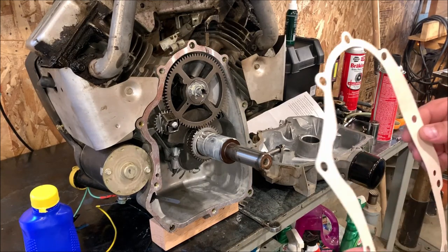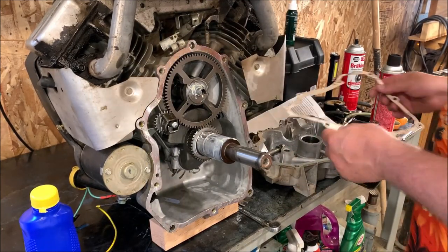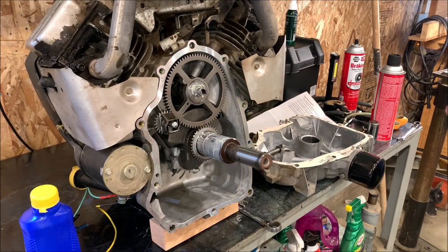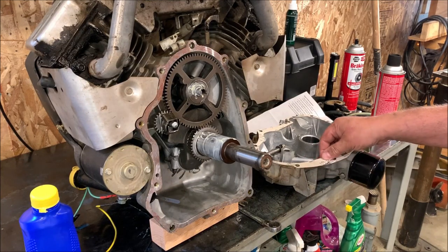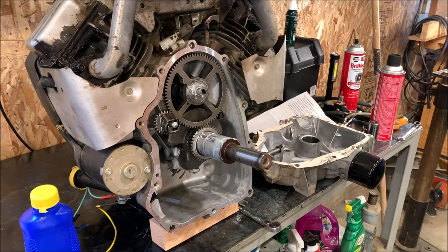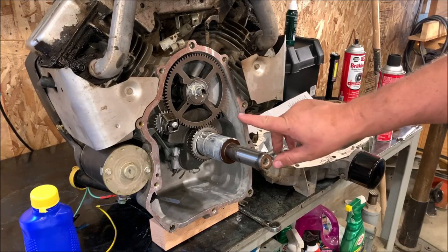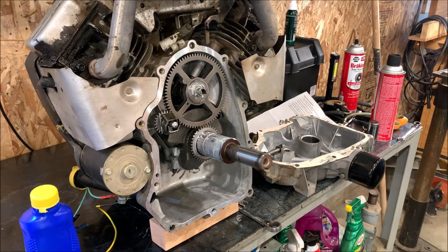I'm not going to use any gasket material or gasket shellac or anything on the gasket. The original gaskets are put together dry, and that's just how we're going to do these, simply because you can actually inhibit the gasket working properly by putting some gasket products on some of these, due to the fact these gaskets are designed to react a little bit with oil, swell a bit with oil, and create an even better seal. So anytime you put stuff that prevents the oil from getting to it or making it bond to this material here, the aluminum,